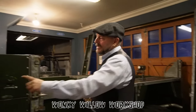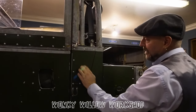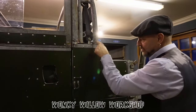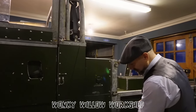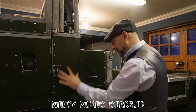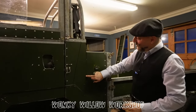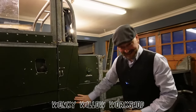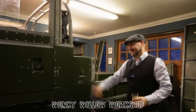Because that's your roll cage, that's a steel panel, that's an aluminium panel. So that there is your steel panel that goes down onto your framework, which is then bolted onto here. So in theory, that weight transferred down through here, down through here, down through here. But these were rotten from there down, it was missing. So they're all basically rebuilt, and I know you can buy them, but...